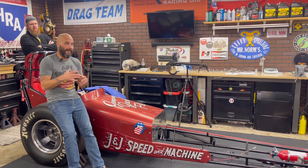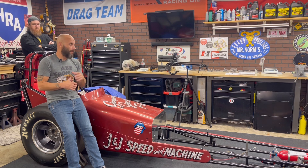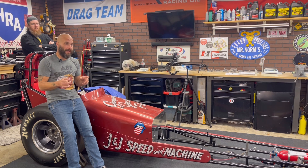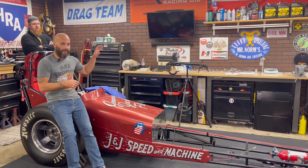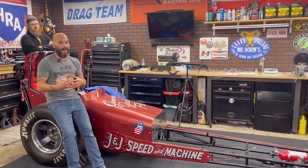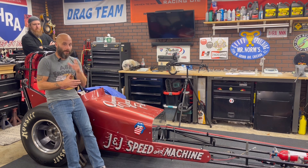We're going to use this video as a test piece. I know I've been doing a lot of what you call engine math lately and showed you different ways to measure and weigh different things. In this video, we're going to be weighing some connecting rods. I already weighed a set, but this is the other set for my 302 build that's going in the dragster. We're going to use the mean average of big end and little end to calculate the actual bob weight for crank balancing. I'm not going to do the crank balancing myself, but knowledge is power - I want to learn this to see how close I was when I get that paperwork back.